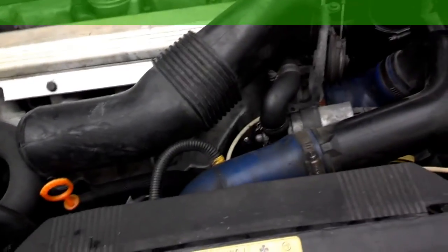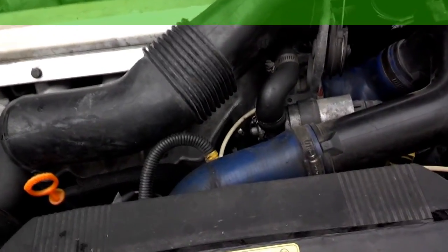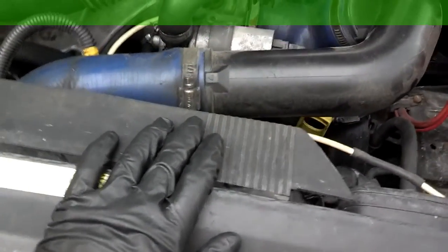Also, this car was an early 96, and like the 95 it actually had an EGR, but it appears that they maybe did an EGR delete on it. The EGR equipment is still down there, but the EGR valve is capped off — that's the cap on the EGR valve. Also, there's no EGR equipment under the fan shroud that is supposed to be there.